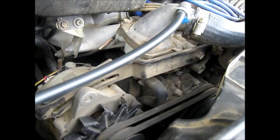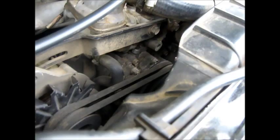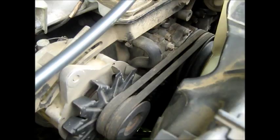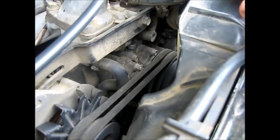We're just looking at replacing this water pump on the Ford Maverick 90DA model, equivalent to any Nissan Patrol. The water pump is basically right there where that nut is, that piece there. You might have to take this plastic cowling bit here off the radiator. First, drain the coolant — we're just going to take the bottom hose off the radiator, then take this cowling off. Then undo these bolts on the alternator so the belts can come off.